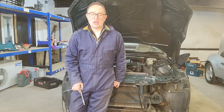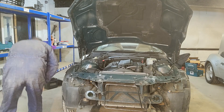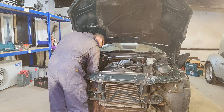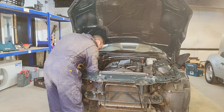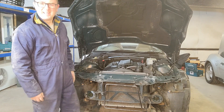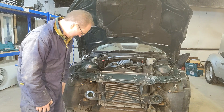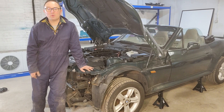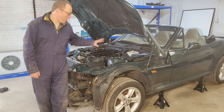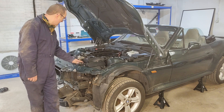With the bumper shocks off it's time to start getting messy and drain the coolant. You probably can't see that but it's very pink - looks pretty fresh. I think this engine was pretty well cared for. I'm not very familiar with this engine. The one I've taken apart before, the silver one over here, is a 1.9 - this is obviously a two litre straight six, not a four banger. I'm going to take off this air box in order to get to the rest of the clamps for the cooling system so I can take this radiator out.